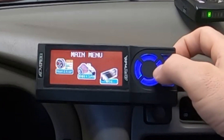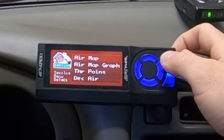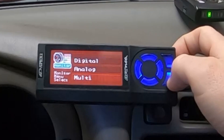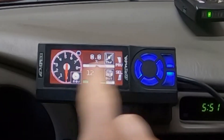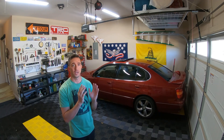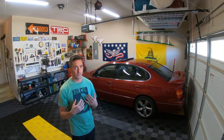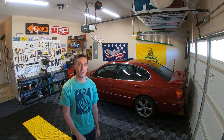If you want to adjust the air map, go in and hit enter — that's where you start messing with your fuel settings. But I want to leave it on Multi Type A for monitoring first. When you shut off the car and turn it back on it'll remember where it was. The Apexi NEO is completely installed on the Lexus GS 400. I'm ready to take it out and street-tune it, so hit that subscribe button so you don't miss the next episode. I do have plans to run it on a dyno in the future, but first I want to street-tune it and see how well I did when I go to the dyno.